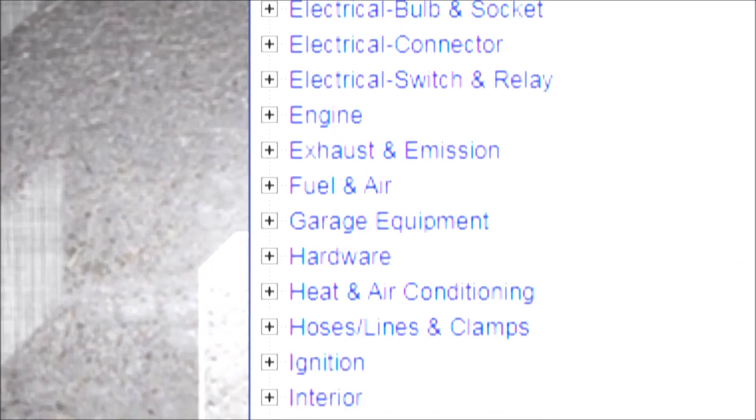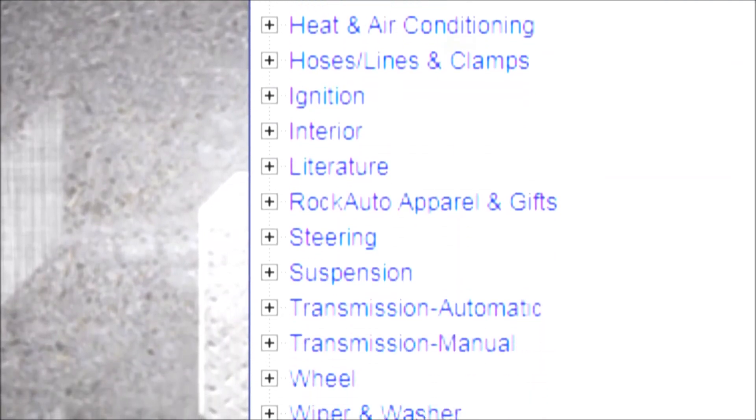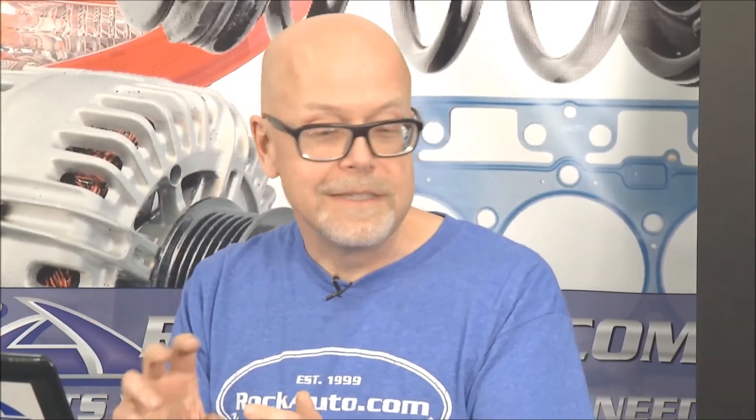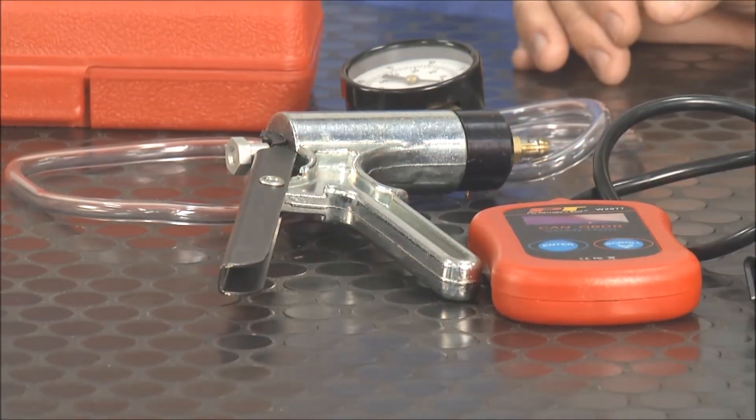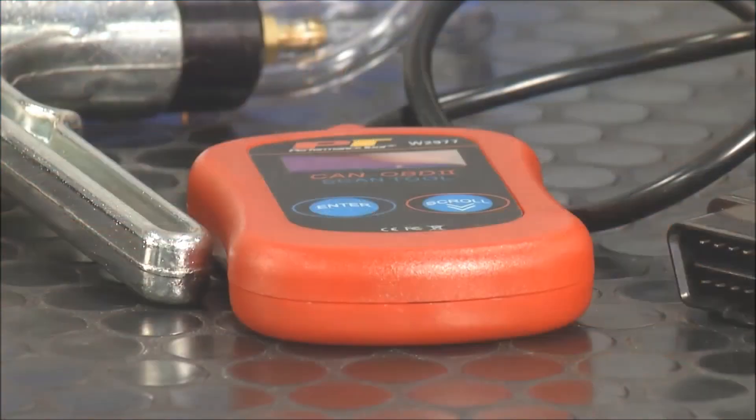Parts like the vacuum pump — you use it to bleed brakes, advance the diaphragm on your distributor — you'll use it over and over again and it makes the job so much faster. Get a spindle nut socket instead of trying to use vice grips and skinning your knuckles. The professional quality of the tools really stood out — these are the same ones professionals use, almost like a Kent-Moore number. Scan tools, everything's there — a great resource. Check them out on the web; meanwhile we'll wrap up with Brian.